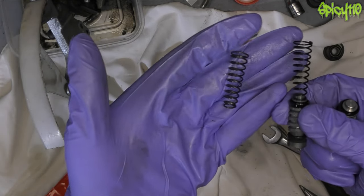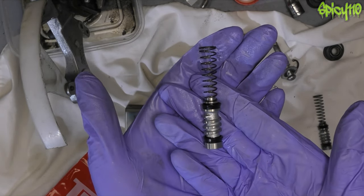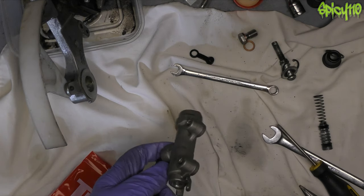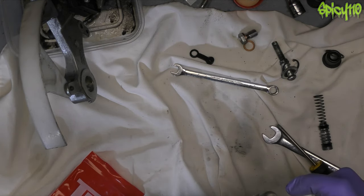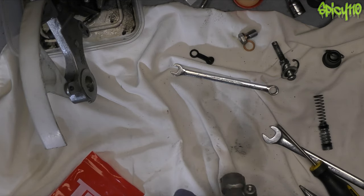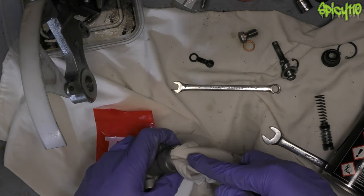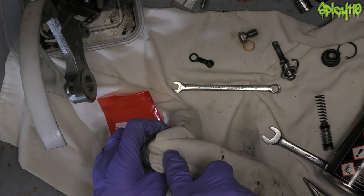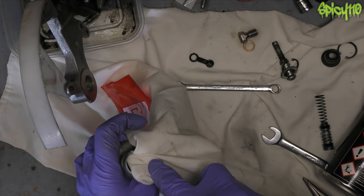Then we've got the spring and you'll notice that's tapered — one end fits over like so. And that is our piston rebuilt. All that's left in the kit is a retainer on that. So that's everything. Just going to use a little bit of brake cleaner just to clean out the inside. Make sure there's no debris. Just using a piece of material on the end of a screwdriver, and I'm going down into the groove that the retainer clip lives in, because there's all sorts of dirt in there and that will stop you getting the clip in properly.